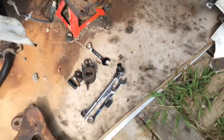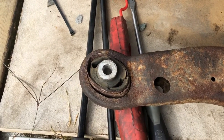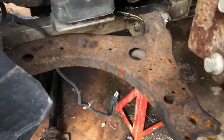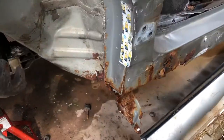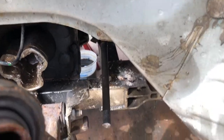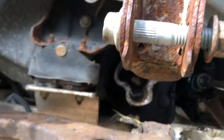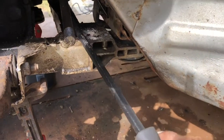So far I've taken the old lower control arm off, and you can see that in the accident it was ripped off. You can also see how oblong that bushing hole is — it's not supposed to be like that, it's supposed to be round. The good news is the subframe did not take any damage; it's straight. But when I got into it, the tie rods were all bent, of course, because it took quite an impact. So I started messing around trying to change the inner and outer tie rods.